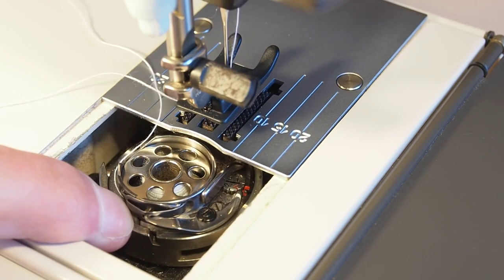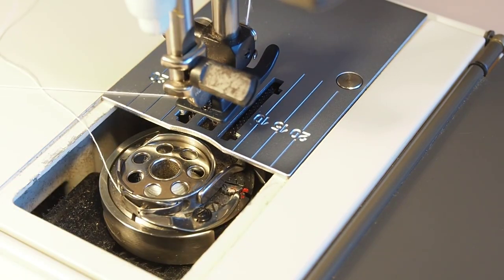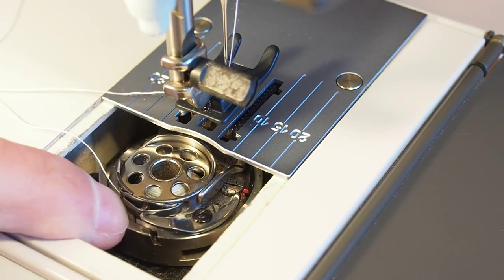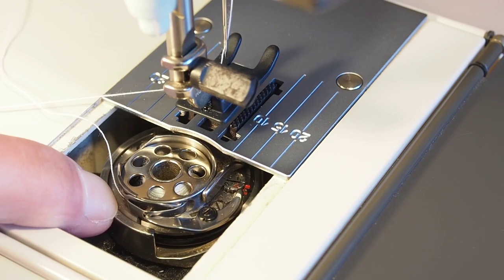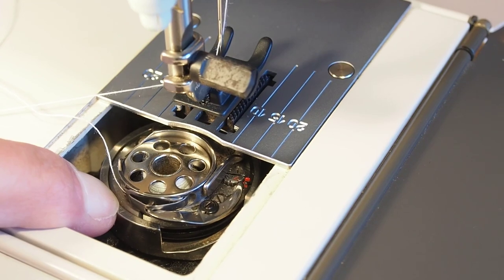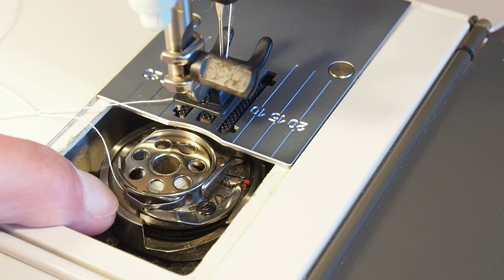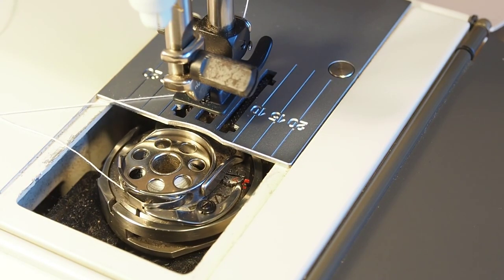to drive there. There's a big patch there. The hook has picked up, the gear's picked up again there. So we're turning, and if I just hold back slightly on the hook, there's a patch. So I'm moving the needle, I'm just jiggling the hand wheel back and forward. You can see the needle going up and down there. But as I do that, you can see the hook's not turning, so there's a patch of teeth missing there. I go a little bit further, still the same, and then go further, and it's picked up on the intact teeth there and has remeshed, but of course it'll be out of time.